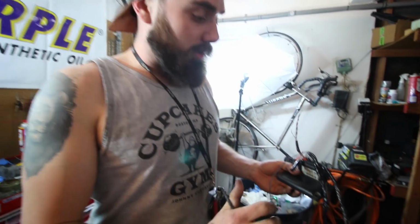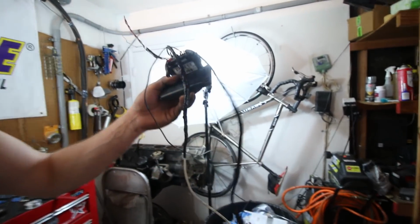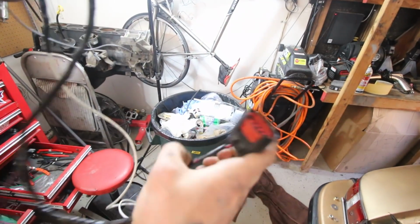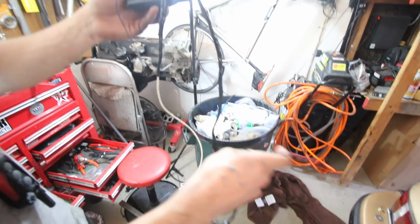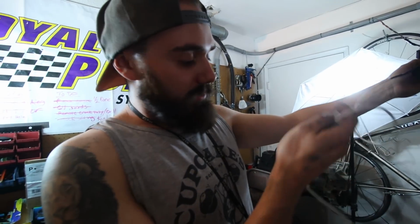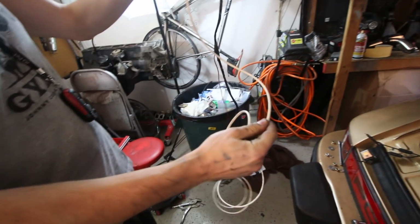I already explained earlier how all the wiring is going to go. I've gone ahead and actually connected these wires over to the coil pack plug. This wire just needs to go to the 20 amp fuse that we have right there. This is way too long, but this is going to go to the VR sensor that's right there. I'll just need to shorten it a little bit.